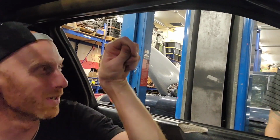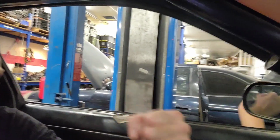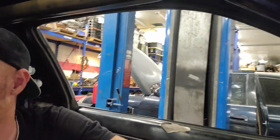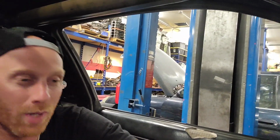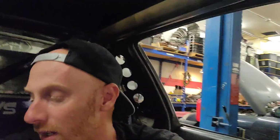So Kelly grabs the power probe. Shout out to Power Probe. Hashtag Power Probe. And then Kelly jams the power probe in there and grounds it out, and then we got 12 volts. So we got a ground problem, which I'm not done installing the harness. That's not a huge issue. I just need to redo it.